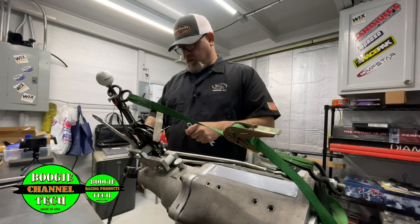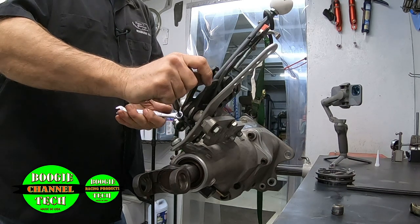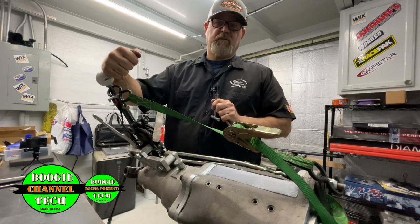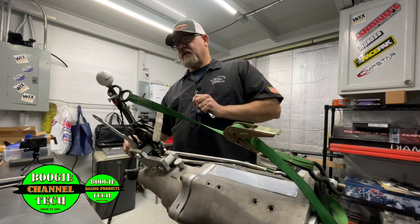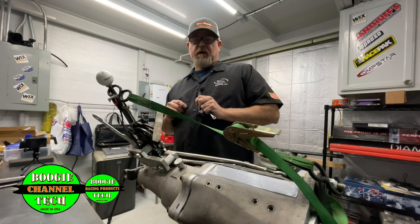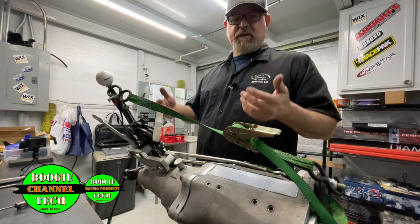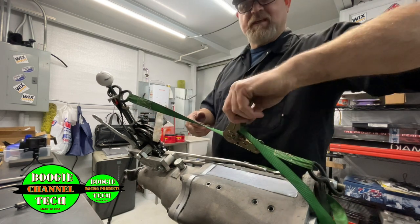If you're doing this in the car, I've got a couple of friends that do it that way. Jimmy Finley's one of them, Tim Hall's one of them — they have to put their shifters on in the car. Jimmy gets somebody to help him; he gets his daughter to get in the car, she shoves it against the stop, he gets under and rocks the driveshaft and feels the drag on the yoke. Tim Hall gets his dad to help him. So you can definitely do this in the car too. Fortunately I can take these transmissions in and out of the Boogeyman and leave the shifter on it, so it's just easier for me to set this up on the bench.